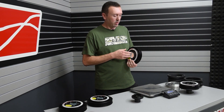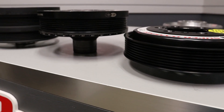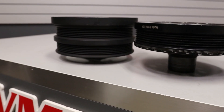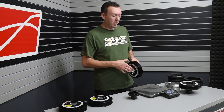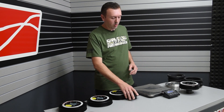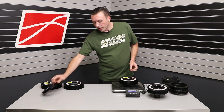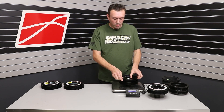So ATI was able to take an entirely fresh perspective on the balancer design. They made the hub shorter, they moved the critical component — the dampening ring — to be closer to the engine block, closer to the front main. It results in a lot of weight being shifted rearward and also making the balancer lighter overall. The accessory belt drive pulley is now just a small pulley that bolts onto the front of the assembly.